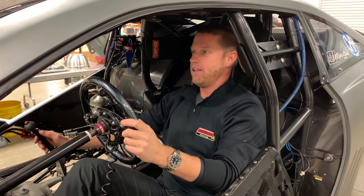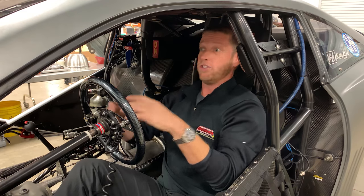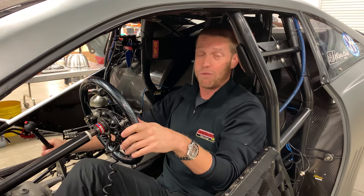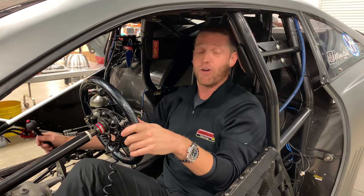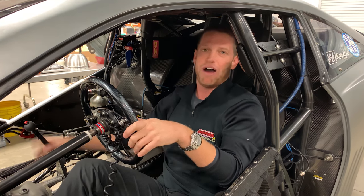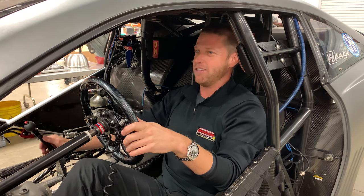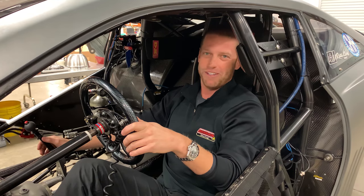in the burnout. You've got a completely locked rear end with a spool, two enormous tires that are turning at the same speed. You've rolled through water, and now you're going to stomp the throttle down on your 4,000 horsepower blower motor. Keep it about 7,500 RPMs and hold it there for about 5 seconds. We as drivers make it look a lot more effortless than it is.